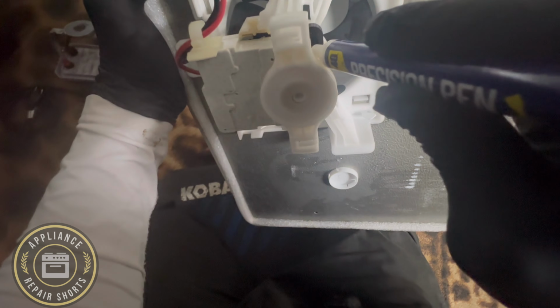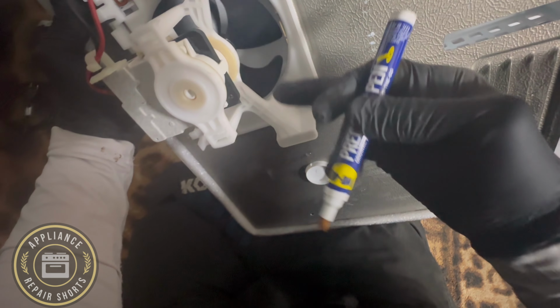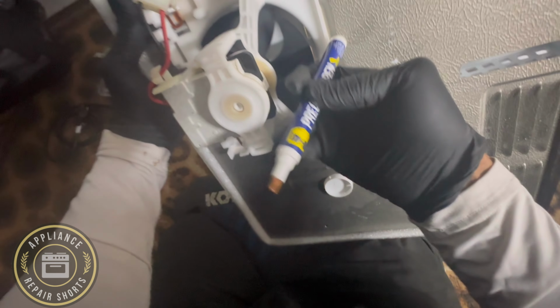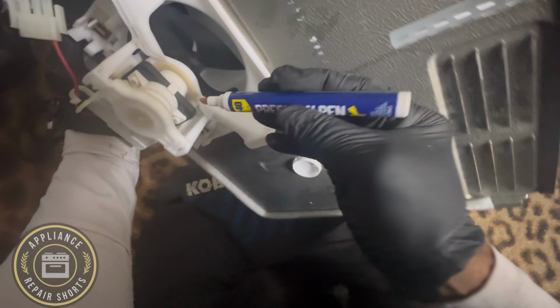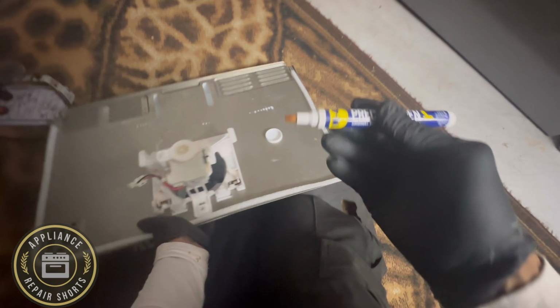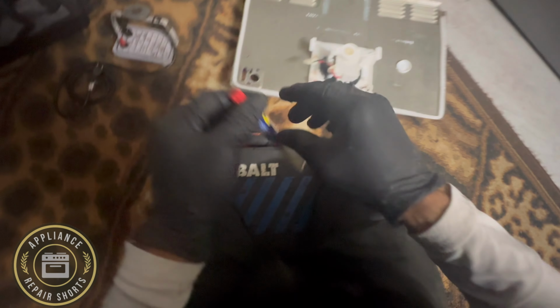All right, so we have a Frigidaire top mount, and of course I'm trying to see if I can get this one going, but it doesn't work. We'll have to replace the fan, and that's how you would do it, by the way. You put your meter leads, set it to volts AC, and you will verify that you're getting proper voltage. On top of that, you want to make sure that you can feel or hear the fan blowing. When the compressor is running, your fan should be running. So that's one sign that you will know that your fan is working on your Frigidaire.